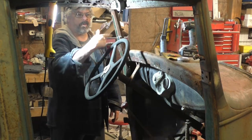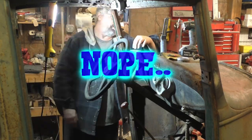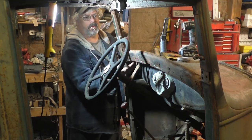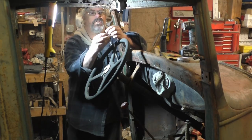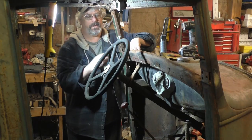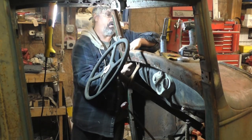All the screws across the front are out, and I pulled the dash out, the little dash rail thing. I think y'all saw that. Then there's bolts under the bottom that go into this dash rail thing that hold the gas tank in. The first one I got on over here broke. There's cage nuts, you can't see it, that hold them onto the backside. The first one I tried to take off broke the cage nut.